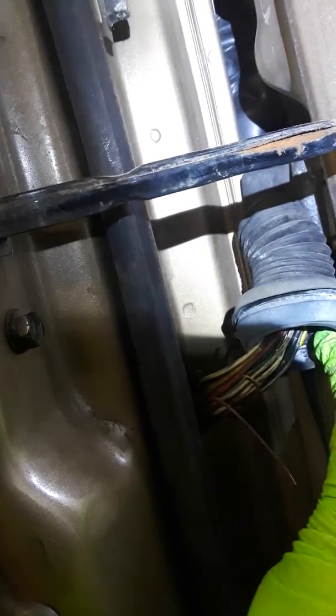But when I pulled this boot apart — I'm sure you guys can see if we can get some light — I found a bunch of wires that are broken and disconnected. There are some more in here. See all those little cut marks? It's not like somebody took something and did this purposely. They're almost like they're dry rotted from the door opening, closing, and bending and binding. So that's what I found.